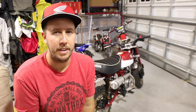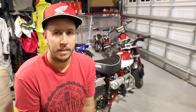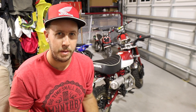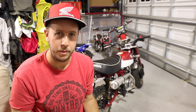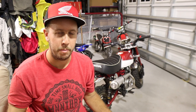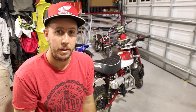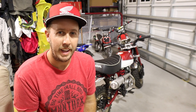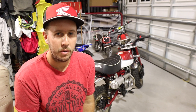It's one of the few exhausts that has only one mounting bolt to the frame. All the other exhausts have some sort of mounting system. Like the Termignoni, which I thought was the easiest before this, had two bolts that were perfectly aligned and welded to the can. The TB and Yoshi pipes have a separate bracket that needs to be mounted to them and then to the chassis, so that adds another step into the process. But this is pretty simple. It's got the welded bracket plate on the can, and that just goes into the frame with a rubber bushing to isolate it from vibration and stuff.